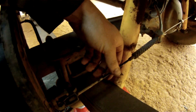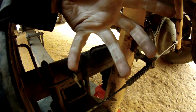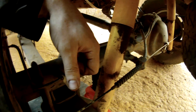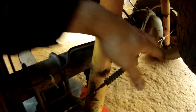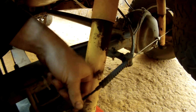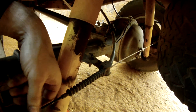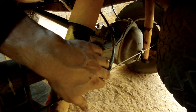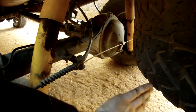One of the big bonuses is they've got a cable-operated handbrake which works on the wheels, which means the handbrake works like a normal car — you just pull it on and it stays stationary. The Land Rover, because it works on the transmission, you pull it on and you're going to have some roll from the slack in the prop shafts, diff, and half shafts. You do have this kind of cable just pinging around at the back here. It seems quite vulnerable, but it's a pretty meaty cable. I assume because it's in line with the diff, as stuff goes past it's going to brush past it.